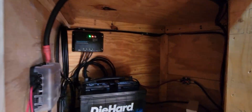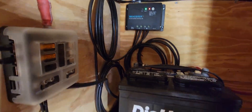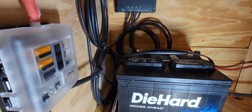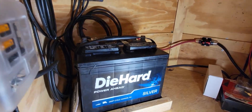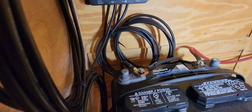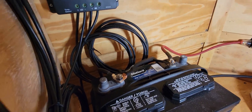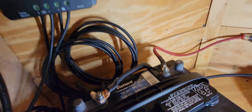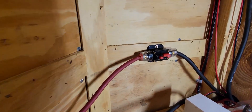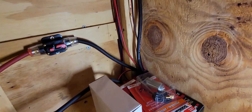We'll talk a little more about the solar panel kit. We got the wires coming from the roof, coming down all nice and tidy. We really didn't want to cut any of the wires, so we just rolled them up and zip tied them. This charger came with the solar panel — it's a whole kit. We had to get a battery from Advance Auto. We got two grounds coming off this battery: one from the charger, one going underneath the trailer to the frame, so it's grounded to the whole trailer. The power has two wires coming off the charger going straight to this fuse, so the main fuse is going to trip before anything else decides to fry.